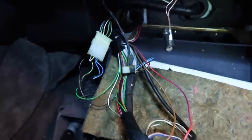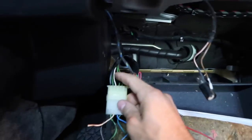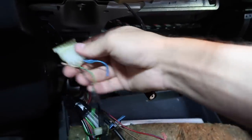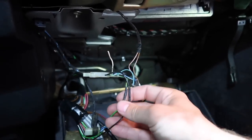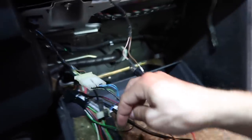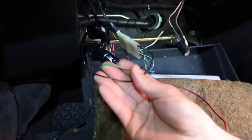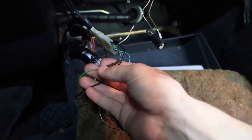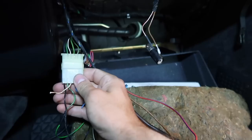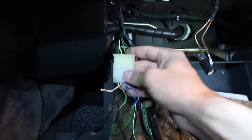And then I realized, I looked at this and it all makes sense now. So I'm splicing in from this connector for power and signal, right, to the ECU. Well, look which side of the harness I chose to wire these into. The harness side, not the ECU side. So what I did was basically, these are coming from C101. These are your signals. This is supposed to be power. And I'm tying them into this connector that is going into the dash harness, basically, like the E28.